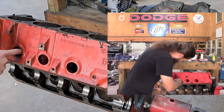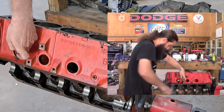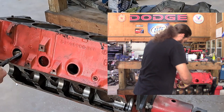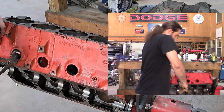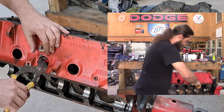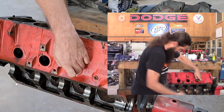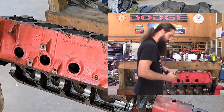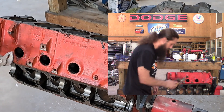Let's see if we can grab ahold of this little guy. They're not too bad. These were brass freeze plugs. However, you can already tell that the inside of this block was pretty crusty. There we go. One. Two. Yeah, it's a good thing we're doing this — this is pretty crusty in here. And three. Not too bad. So there you go — freeze plugs, step one.